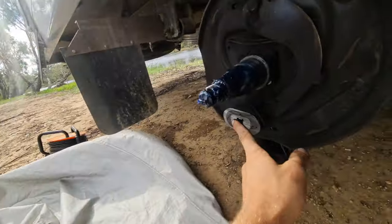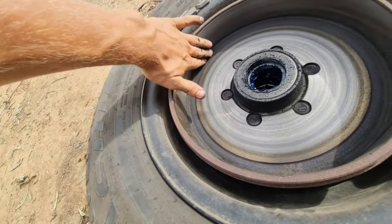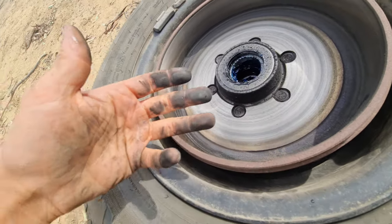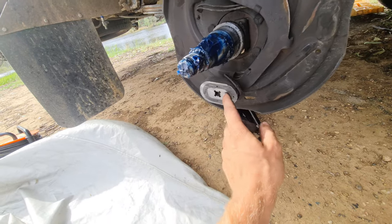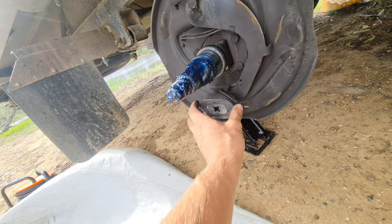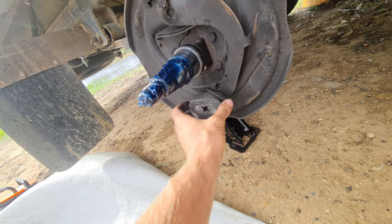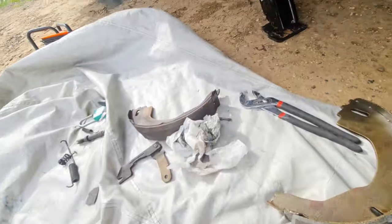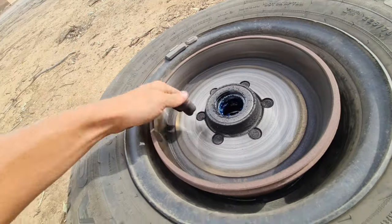If you notice your brakes — when you put your foot on the brake and you're just easing to a stop and it suddenly grabs and pulls you back — and it's almost like a brake and then a grab — that is because this thing is getting too much crap on it. As you're braking throughout the years, you build up all this soot and residue which is not great for your brakes. When too much of it gets in there, it will become almost like it grabs — smooth, smooth and grab and yank it up, not that smooth increasing brake. So if you clean all this out with a bit of degreaser and a paper towel, clean the magnet and all along here, you'll be surprised how much crap you get off.